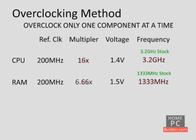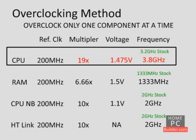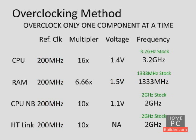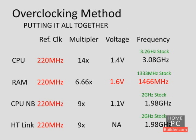For instance, if we tried to overclock the CPU and RAM at the same time and the system became unstable, we wouldn't have any way to tell if it was the CPU or the RAM that caused the instability. What we are going to do is use a combination of reference clock and multiplier settings to overclock one component at a time, while keeping the other components at or below their stock speeds. This will ensure that there is only one possible cause of instability. Once we have found our CPU's maximum frequency, we will use its multiplier to lower the CPU's speed so it is at or below its stock setting. We will then find the maximum speed of the CPU North Bridge and HT link using reference clock and multiplier settings, making sure we keep the other components at or below their stock speed. We will use this same isolation process on the memory to find its maximum speed. Once we have each component's maximum stable frequency, we will combine the overclocks so that all components are at their maximum stable speed.